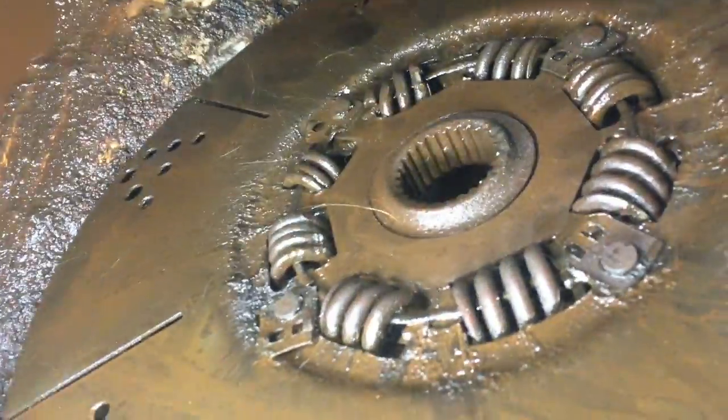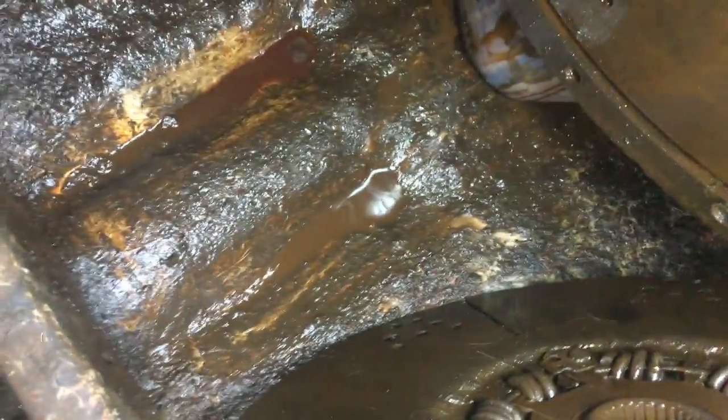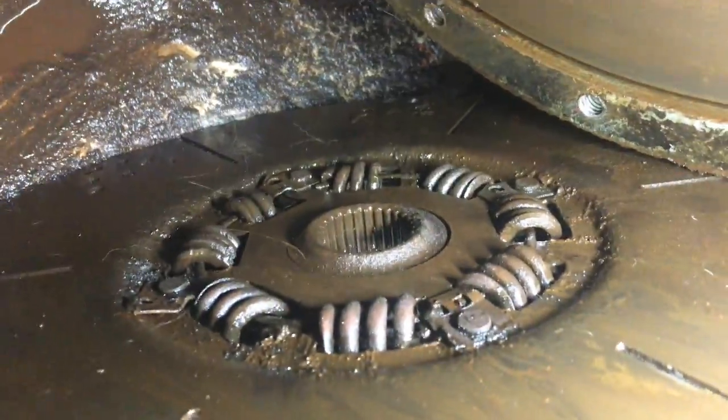Just want to give you a little update here. I completely took the transmission out - stuff is covered up so it doesn't get dirty. This is the back of the engine and this is the drive damper. When I took this off, I had all these little metal chunks sitting right down in the bell housing. They were coming from these springs here. This drive damper absorbs the sudden shock of going into gear, and it just wore out - all the springs are breaking and broken, and they're all down here in the bell housing getting caught up and grinding.